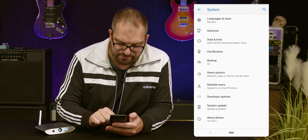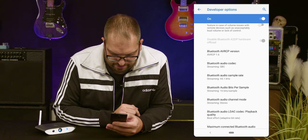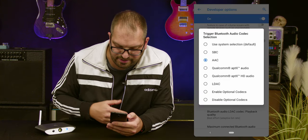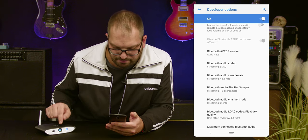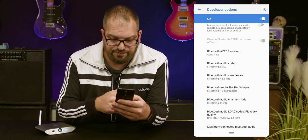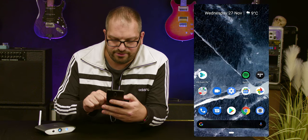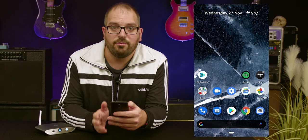Come out of there and you'll see we've now got Developer Options in the menu. Scroll down in Developer Options and we should see Bluetooth. I'm going to change the codec — you'll see I've gone to AAC and the little logo here has gone yellow. If it's on SBC, which is the standard Bluetooth protocol, it goes green. Then let's swap over to LDAC and it's gone blue to signify we're on LDAC mode. Next, we're going to change the sample rate. The blue light means we're on 44 and 48k. If I go to 96k it should go white and 24-bit. It hasn't done that yet because I'm not playing any audio — if I go to Tidal and put some audio through, there you go. The light has now changed colour to signify that we're working in those high-res codecs.